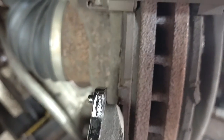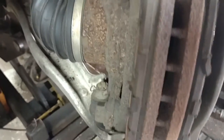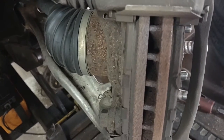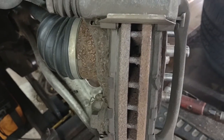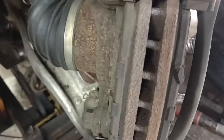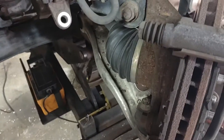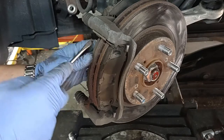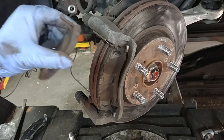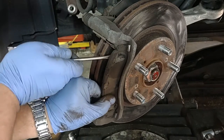As you can see, I hung the caliper here — there's no tension on the hose this way. You can see how low the brake pads are compared to the new ones. This car came from an oil changing place and they were telling the customer the brake fluid was low and they had a fluid leak. As soon as I heard that, I knew they had very bad or very low brake pads — and that's the case. You can see how low they are compared to the new ones.